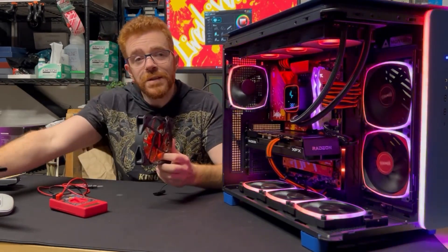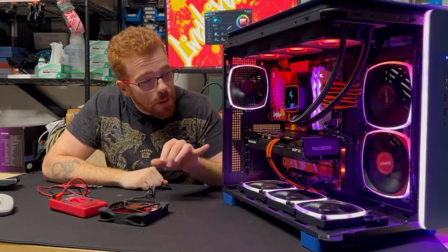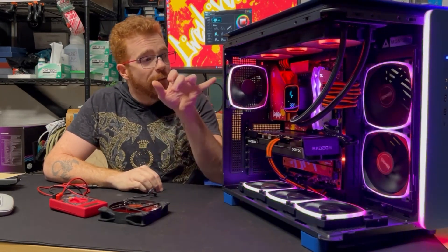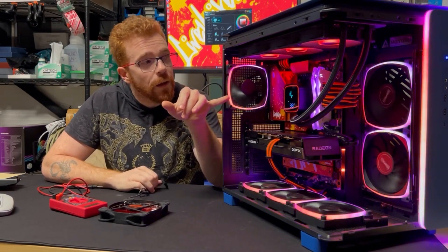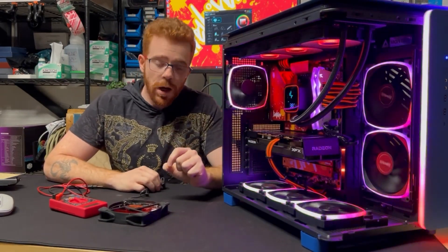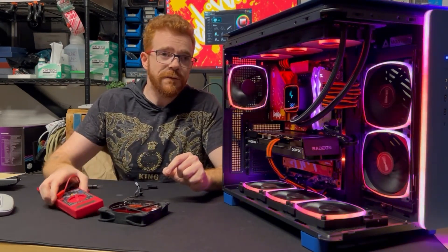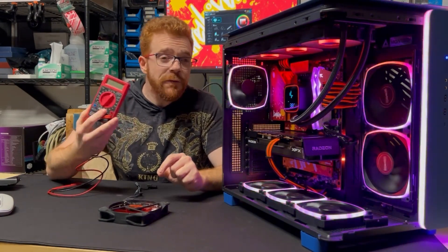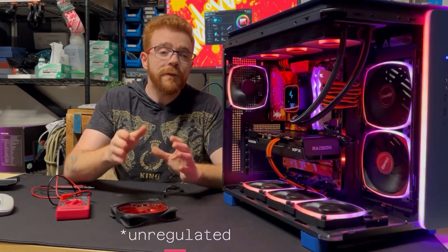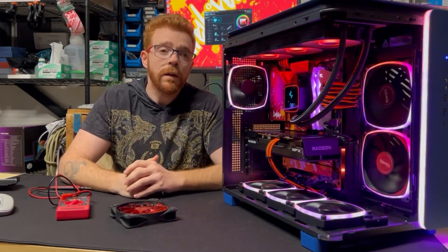People who do this with their electronic duster and don't stop the fans will blow out the standby power circuit for turning the system on, blow out VRMs, destroy their CPU, blow out voltage regulators and transistors. These components on motherboards are extremely tiny — the size of a grain of rice or smaller — and you're pumping five to six volts and showing AC voltage at the same time, creating a ripple effect in current generation. So you have unprotected voltage, unprotected amps going backwards into a system in the direction it was not designed to withstand.